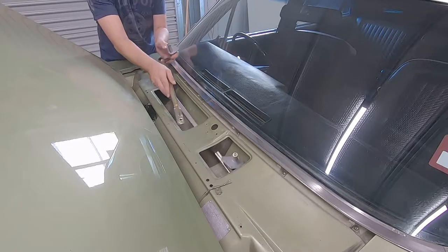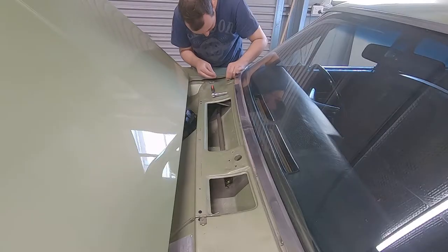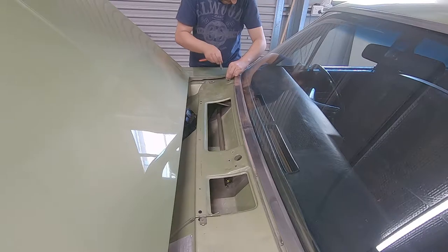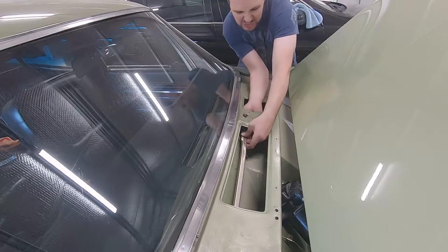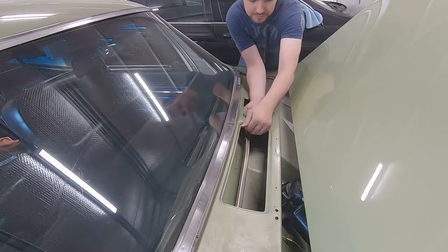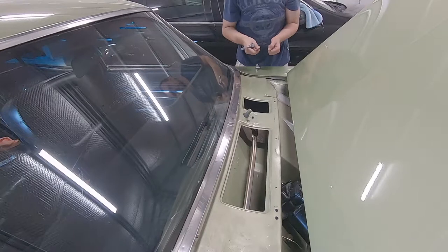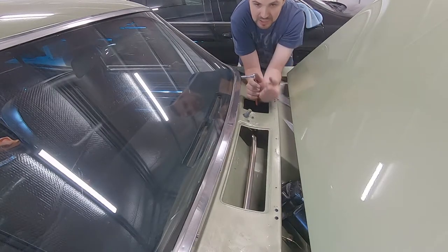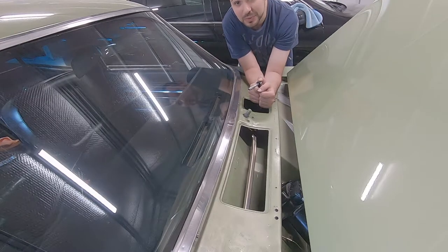Let's whack it in — only six bolts, pop the clip in and then give it a test. What have I got to lose, 200 bucks? It's going to line the three holes up. So the best way to do it: plop it in, move it all the way to the passenger side of the car, position both sides in the holes and bring them both up at the same time. You can't put one in, tighten it, and then put the other one in — that's what you learn when you do things the hard way, and that's how you learn to do stuff that you hopefully will never have to do again, but now we know for next time.